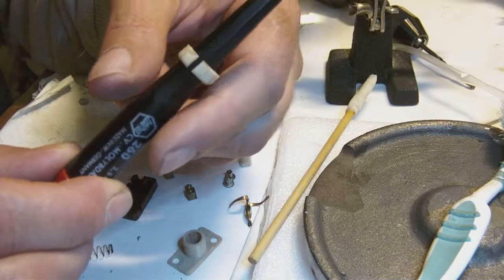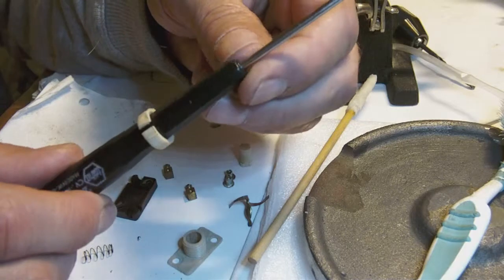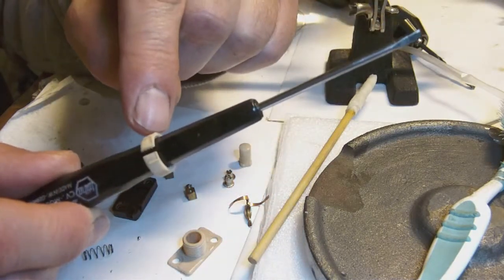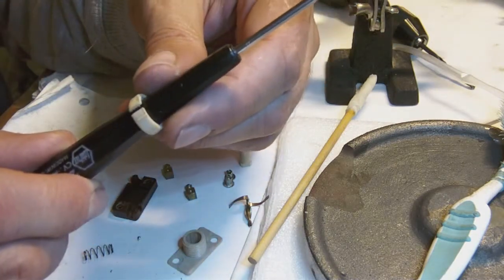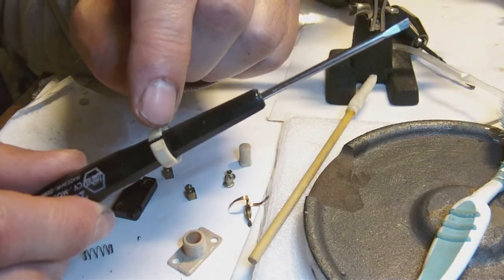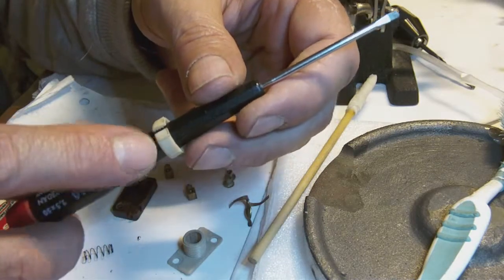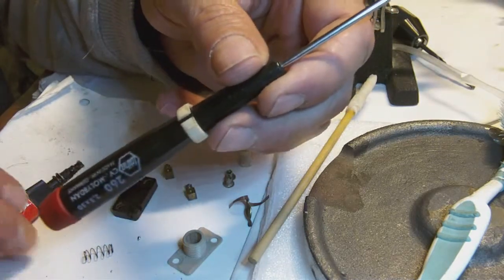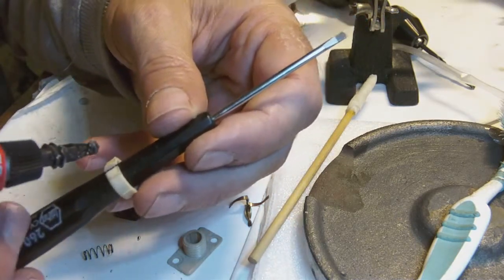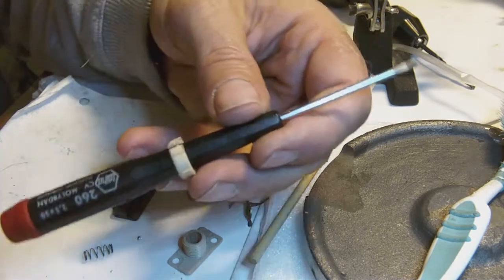It widens as I go to the top of the screwdriver, and it has a starting diameter smaller than the inner diameter of the ring. So you slide it over gently, and then you widen the gap a little bit, not too much, mind you, or you might crack it, but just enough to drip a tiny drop of super glue in it, like this. There you go.